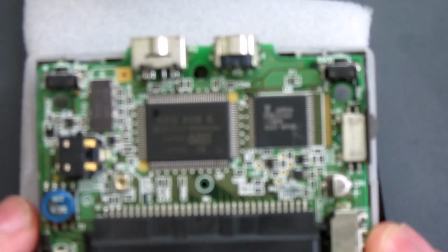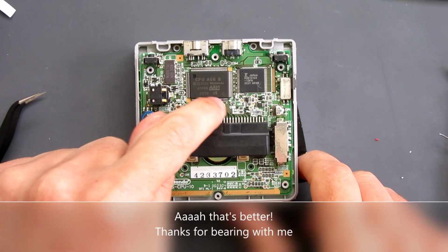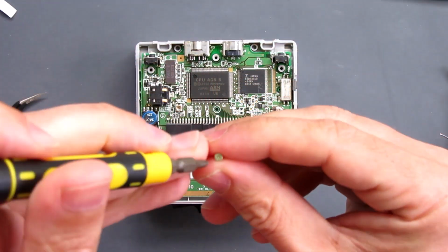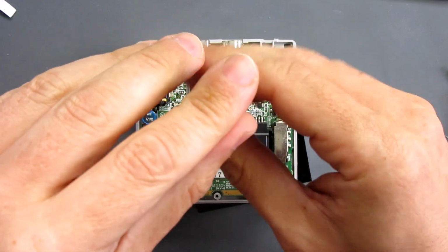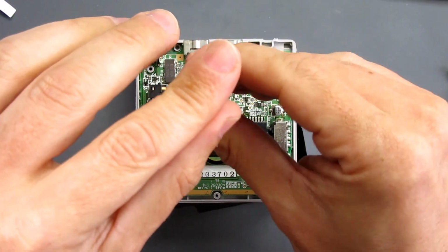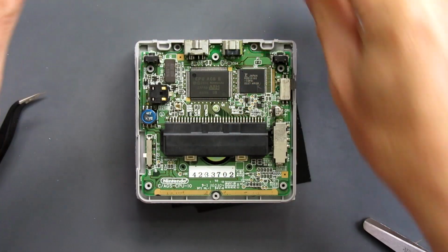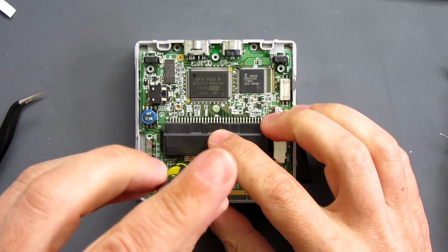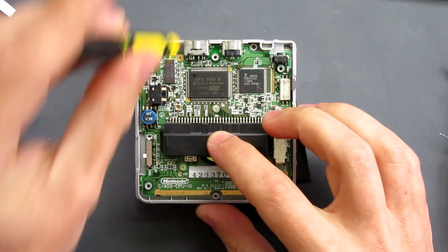Right, so now we can do this. We'll take our motherboard, flip it over, drop it in position. I've got 1, 2, 3 screws to go in here. They again are crosshead screws. And again, it's a fresh hole, so I'll keep going in and back out. Just like a side to side wiggle on the screwdriver just helps to cut the thread neatly. It makes it less likely to burst out as well. It's not going to put any undue strain on the plastic.